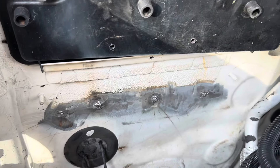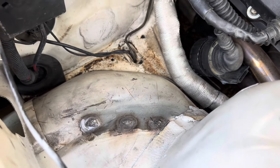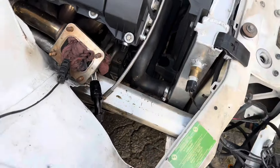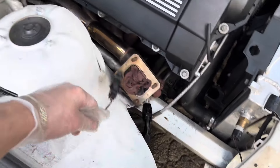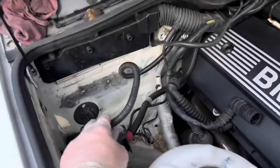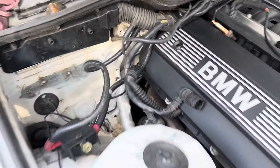Got the welder put away, cleaned up, got everything patched up. It's not a thousand percent perfect but they should grind flat and not have any pinholes - I tried to fill it really nicely. I'm going to get those grinded flat and try to get some primer thrown on them, maybe just some white paint like I did here. Of course it's not going to match perfectly but someone already repainted this car before anyway. Going to grind these flat with the flap disc - got a worn out one that's good for stuff you don't want to grind too much.